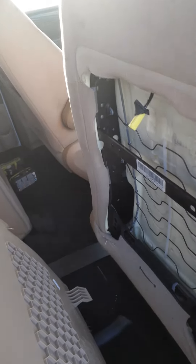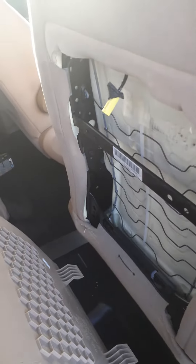How to repair the headrest on the 2014 Dodge Caravan. Just remove the rear plastic cover seat by pushing up like this, pressing to the sides on those clips, and bring it down from this clip.